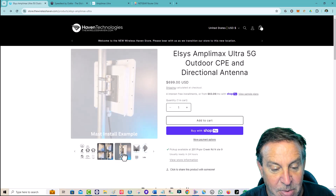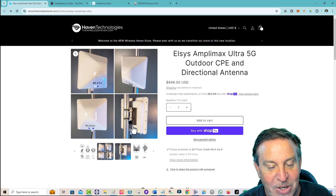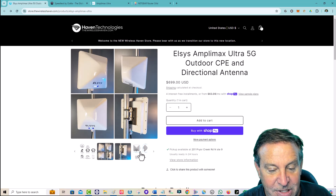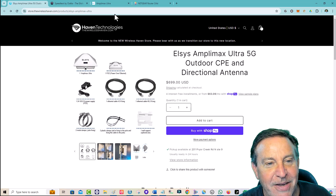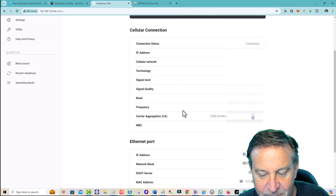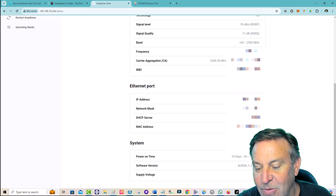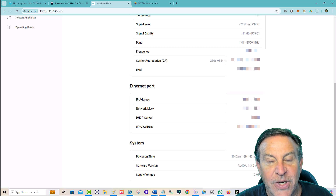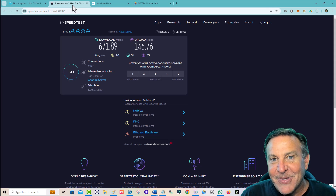It comes with a 49.2-foot cable, but you can go up to 300 feet. To check you have enough power at that distance, go to the supply voltage page — right now it's about 19.9V — and just make sure it stays above 9 or 12 volts. Richard will have that specific number. That way you know your modem is getting enough power. This is the neatest modem I've ever seen because it pulls scores exactly like this. See you in the next one, guys!